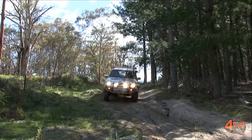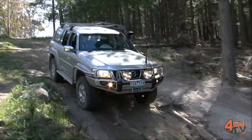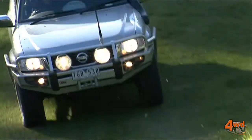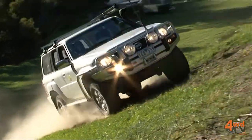The downside with halogen is that the wire filament is pretty fragile, and that means when you go over lots of corrugations and vibrations it's prone to breaking, which can shorten the life of the globe. The other thing is that they draw a lot of power — whether it's a 100 watt or a 130 watt high-wattage globe — if you leave them on while you're stopped, it's going to draw a lot of power from your battery and you can run the risk of flattening your battery.